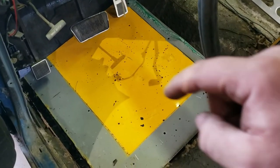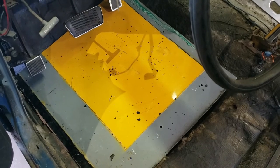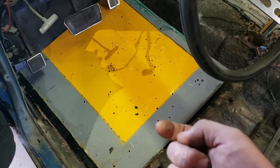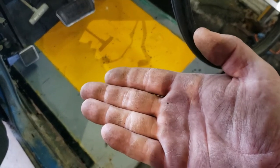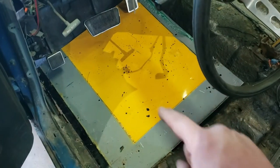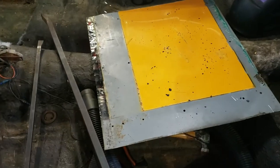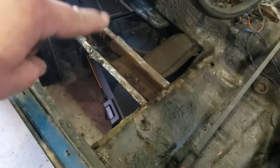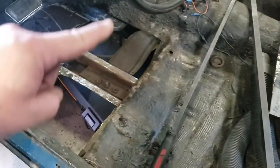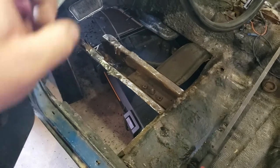Once it's all welded up, we'll find where the frame piece is, drill some holes, and plug weld it — that's what it's called. That means we're going to drill through the flange or lip on the frame rail but not through the floor pan, so that we have a backing and we can weld to it. It's going to be easier to remove this piece, drill the plug weld holes now while we have access to the frame rail, so that when we start tacking the piece around the edges, the holes are already drilled.